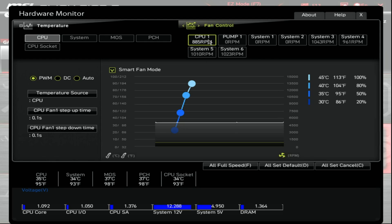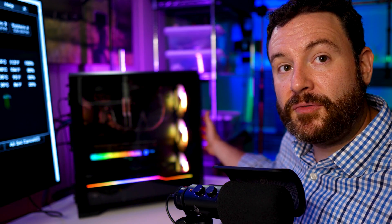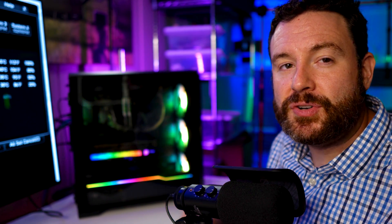This is our CPU fan curve, and you can see the same setup applies to our system fans as well. All fans inside this case are now ramping in the same general way, because the exhaust is going through a radiator and we'll have some natural resistance. We're going to have positive air pressure coming in from the front of the case, meeting a level of resistance, so we'll draw more air in from the front and it will find areas to exhaust out the back. With the radiator at the top, it would be very difficult to balance, so positive pressure is the direction we want to go.